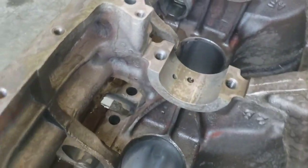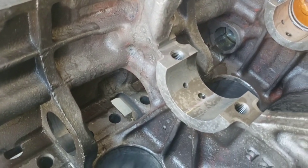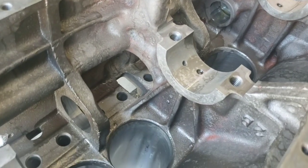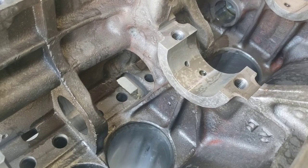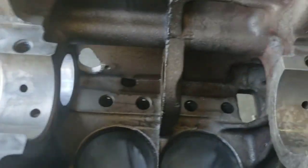Okay, so these engine blocks are sand cast. And when you go through numerous heat cycles and then a rebuild process and hot tanking them, all that kind of stuff, you can loosen up some of those little sand nodules that remain. Little carbonaceous defects in the sand casting back in these pockets can let foundry sand out into your engine. So that can be disastrous.